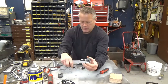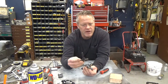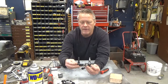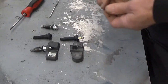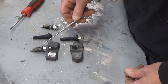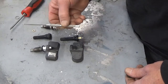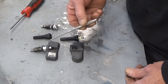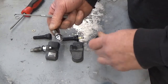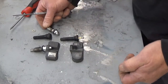Now what can we do about this? You may have seen sensors that have a rubber valve stem. This stem will last — rubber valve stems have been around forever and can essentially last the life of a vehicle. So I want to use this rubber stem on this sensor, and I found a way to do it. The factory aluminum stem has a ball fitting so once it's in the wheel you can adjust the sensor's swing in or out, making it easier when mounting or dismounting a tire. We're going to need something like that ball fitting, and I was originally going to cut it off and use it.